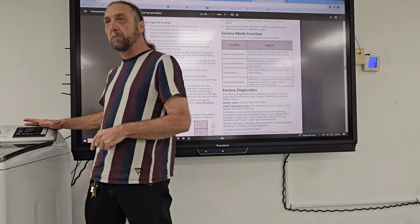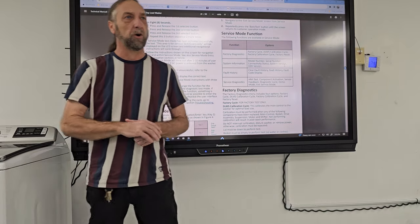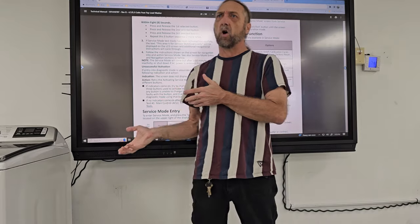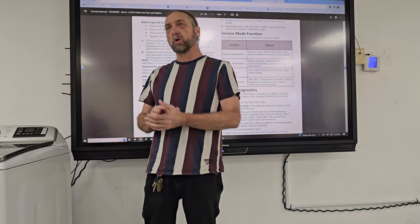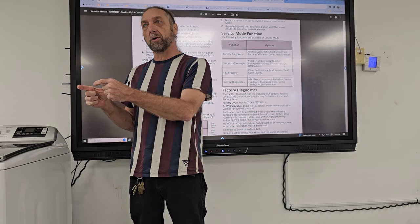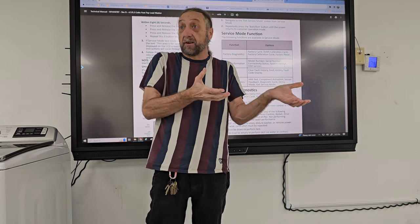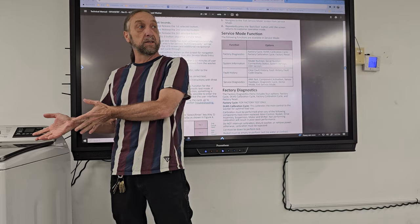I had one guy change the main board and change the motor, and he was getting an error saying Hall sensor error. Do you guys know what a Hall sensor is? A Hall sensor is a sensor that senses the speed and rotation of the motor. But he's getting the Hall sensor error. He says, I changed the board, I changed the motor, and I said, well, if you look at the shifter on the motor, we'll look at the diagrams later, that's the part that's actually sensing the speed and rotation of the motor. I said, that's the part that's probably failing if it says it cannot sense the motor running, and if you already changed the motor and the board, the shifter, what senses it, is probably the part.